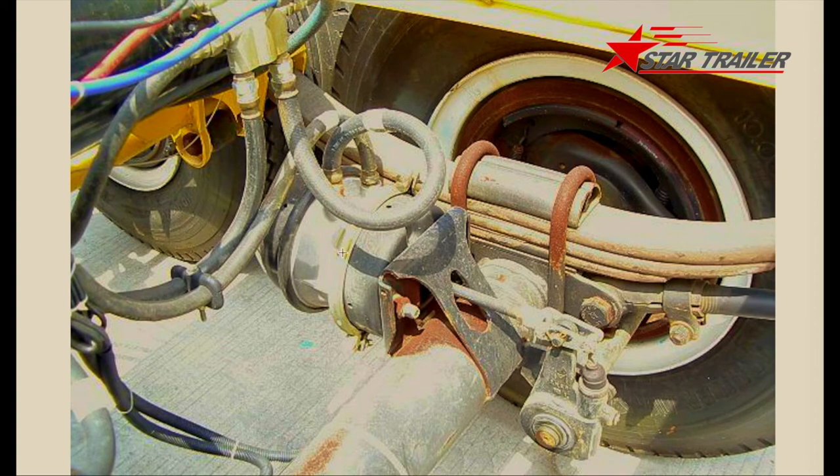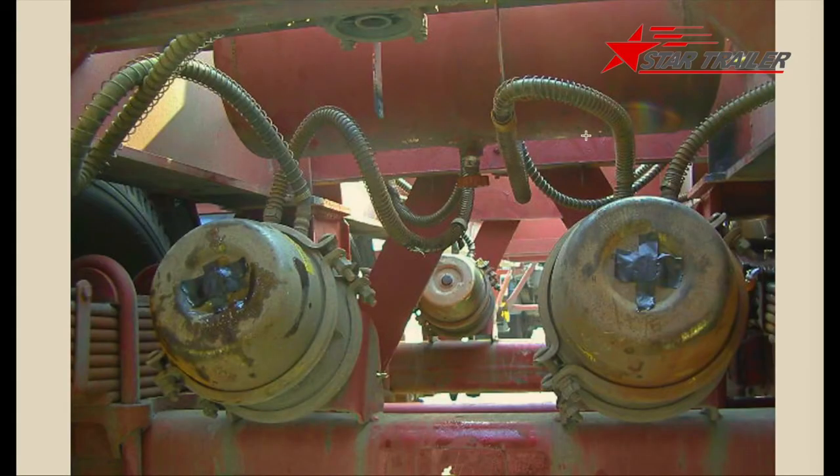Here is a picture of part of the system — I cannot find a picture showing the whole trailer without the frame outside, so I show it part by part. This is a double chamber, this is a braking hose made of rubber, and the red line here is the supply line — it has air pressure all the time. The blue line — it's not yellow because the American system uses blue color. Here is the braking drum, a spring, and an axle. You can also see the air reserve tank on top, having pressure through hoses to the air chamber.